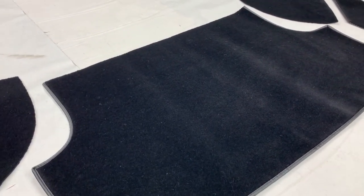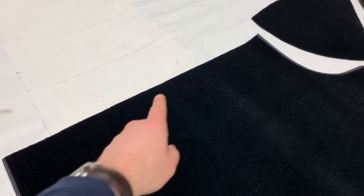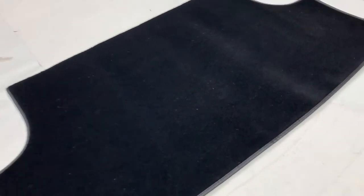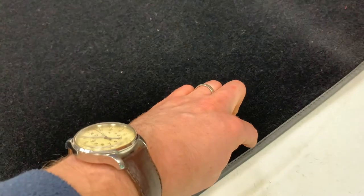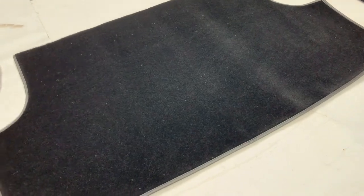This has been done in wool in black and it's been edged in leather cloth. It only gets edged on the three edges — the back edge is not edged because it's hidden by the boot liner petrol tank board. It's worth noting that just in the middle here you'll see double stitches for about an inch or so. That is what we call back tacking, done deliberately as on the TR boots on the early cars it had a reinforcement plate that slipped through — so you can effectively cut that into a T-slot around the bracket without disturbing the carpet, so the carpet can sit fully back in the car.